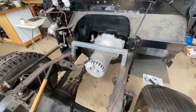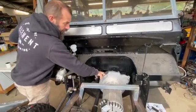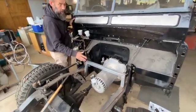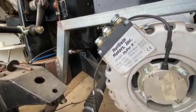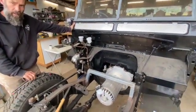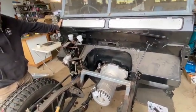This is your motor installed. We've connected it to the clutch and shaved a bit off the flywheel — we probably could have shaved more but we'll see how we go. We're still using the original transmission, transfer box, and all the Land Rover gearbox behind this — this replaces the petrol engine. So what is this motor? It's an AC NetGain Hyper 9 — 120 volts, producing up to about 100 kilowatts, which we probably won't be running at full. Considerably more than the original four-cylinder 2.25.